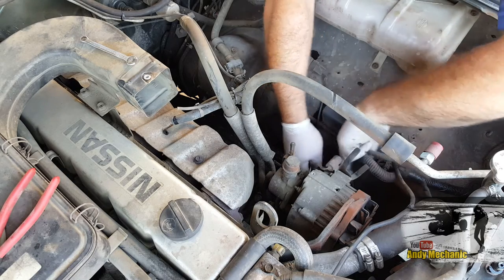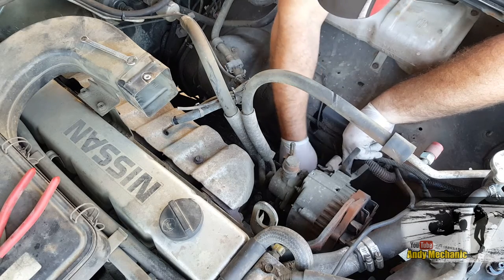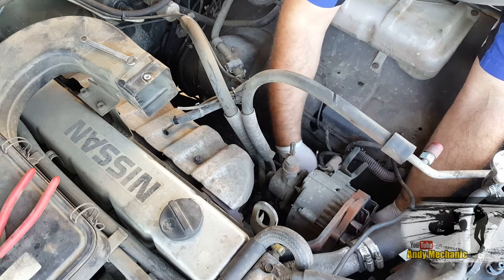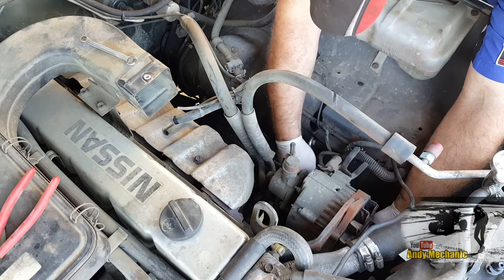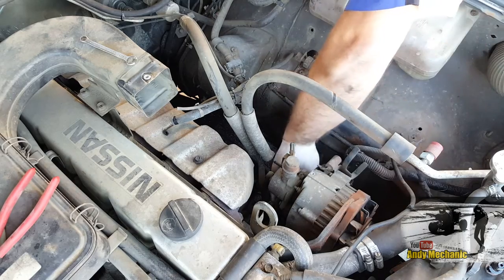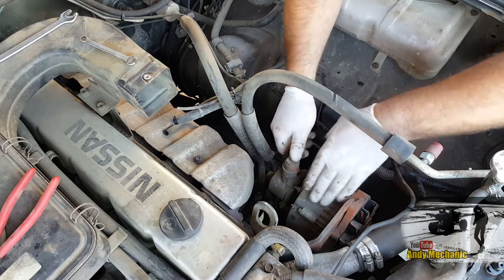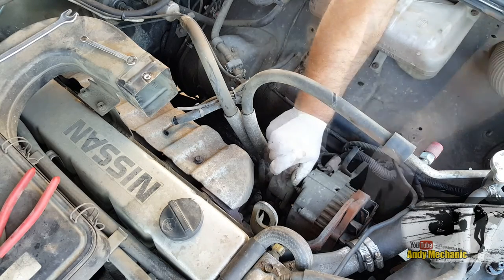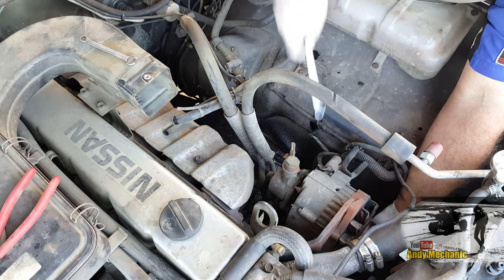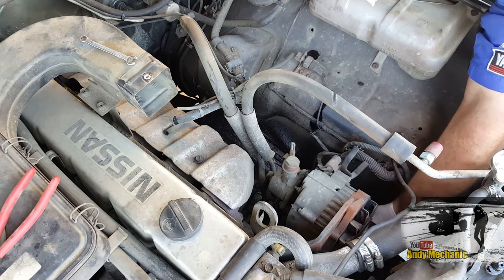See if we can get that cracked off. Now these are usually very tight. I just want to crack it off to start with. Sometimes they're captive and sometimes they have a nut on the end — this one's captive. That's pretty slack now. So I should be able to move that alternator. It's got two pivot bolts — one at the front as well. Sometimes they have one big bolt that goes all the way through; this has got two separate ones. Just crack that one off as well.